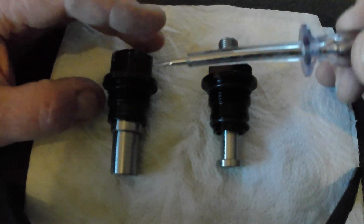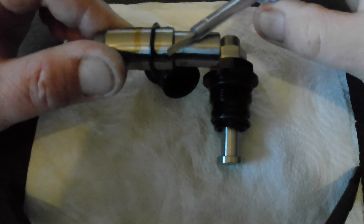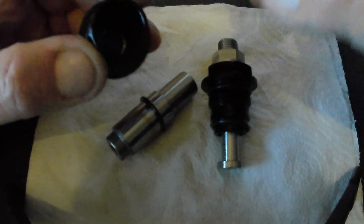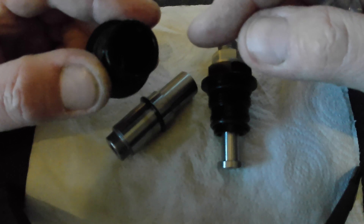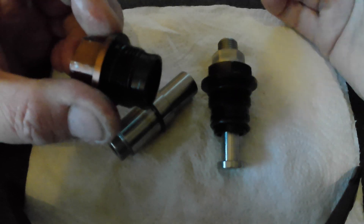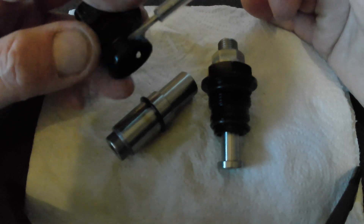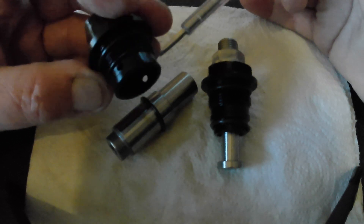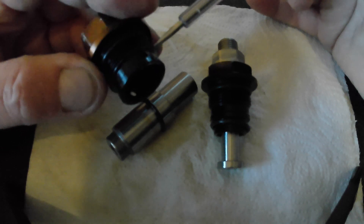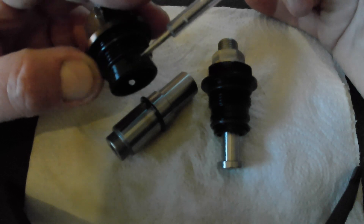The hydraulic version, or the original version, has two rubber seals — one here and one at the bottom on the plunger. There is no groove that it sits in; it gets squashed between this flat face and a corresponding flat face within the engine cylinder block. The groove here is not for putting the seal into — it is to allow oil from the oilway in the cylinder block, because this might not correspond to where the oil feed is as you rotate it while screwing it in. That oilway allows oil to flow around.